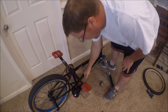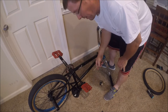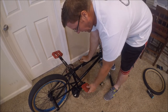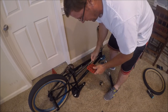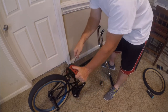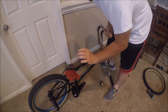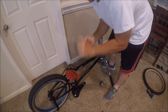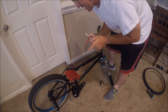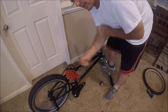So you're trying to figure out how your pedals go on — you know which is left and which is right because they're marked, but you can't remember if they thread forward or backward. Here's the key: if you pedal forward, that is the direction they tighten. It makes sense because if you crank forward and it went the opposite direction, you'd be loosening it every time. So they made one side reverse-threaded so that cranking forward actually tightens it.